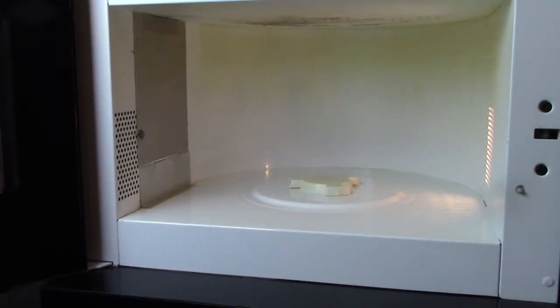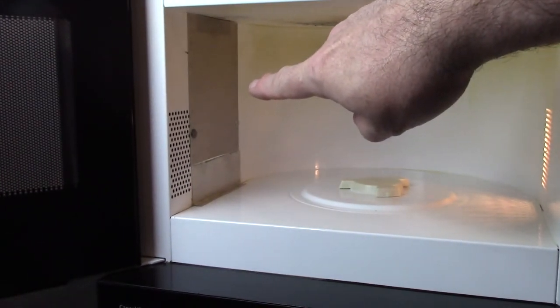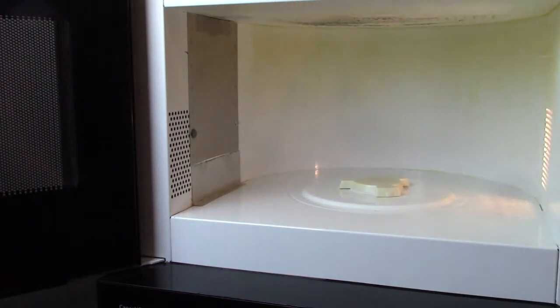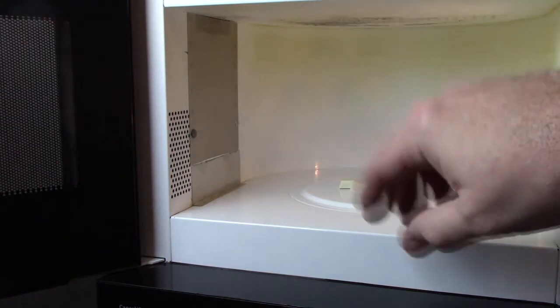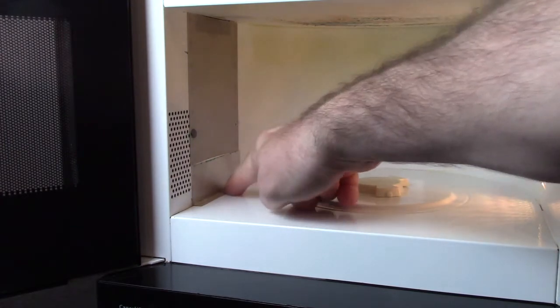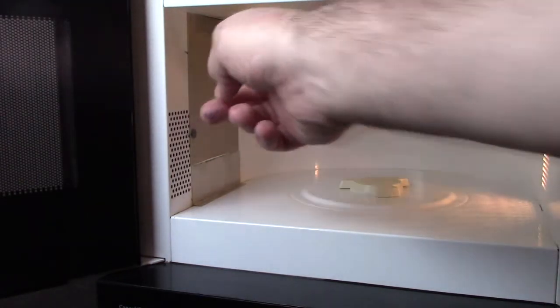So here's my microwave, and you could see right there is the mica sheet, and I just held it in place with instant glue. There's only one little tab on mine that holds it, and the instant glue I just put into all the little corners, just a slight amount. And then if you have an opening on the bottom, I just made a little L piece to ensure that no moisture gets in there. But whatever's on your microwave, that's what you're going to duplicate and add the new product, the new mica sheet, to your microwave.